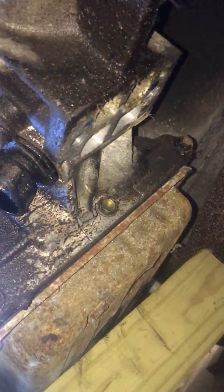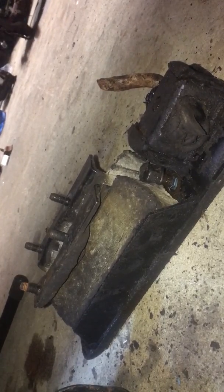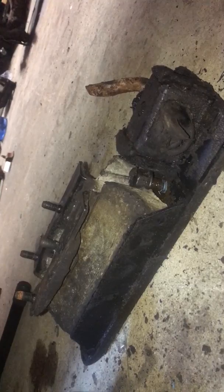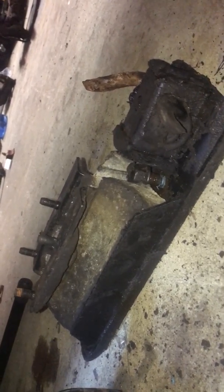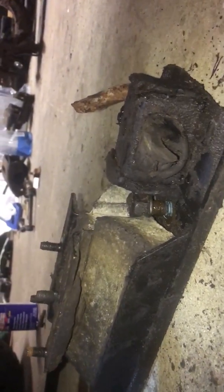What's happening YouTube, here we go again continuing on tail shaft housing. I took off the skid plate and then the transmission mount — that's a rubber mount — and that's the exhaust mount. Luckily mine already broke off so I didn't have to worry about the exhaust, but in your case you will need to take out the stud from the rubber mount.